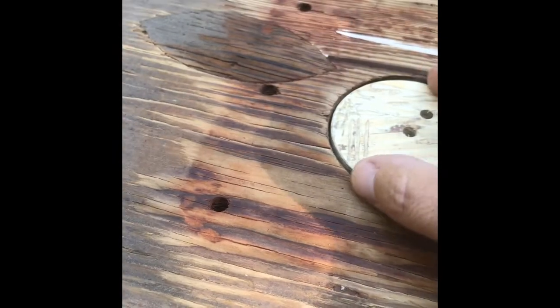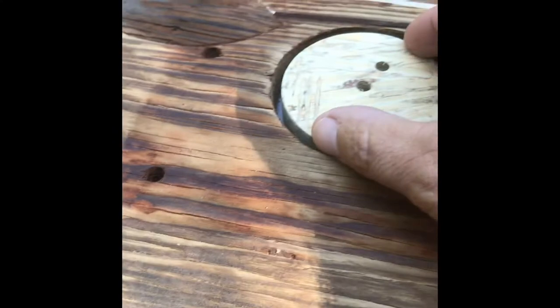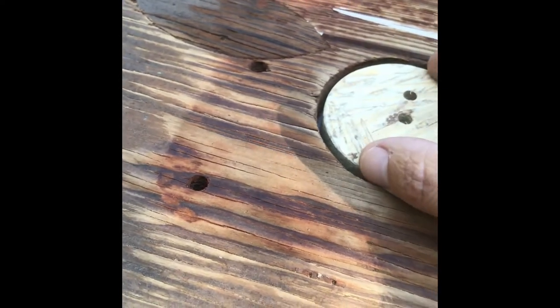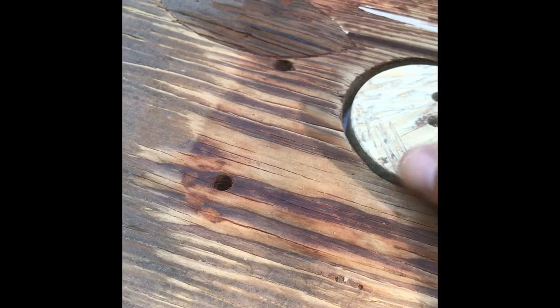That's how I ended up making the plugs I'm using to plug this boat, and that's what you end up with right there. It's pretty much ready to drop in. I used the three-inch hole saw to cut the hole, so the blade width leaves about an eighth of an inch gap all the way around — and that's exactly what I wanted, so the resin runs all the way around and centers that plug up in there.